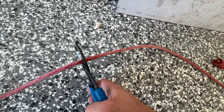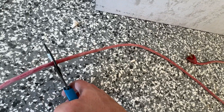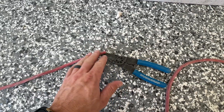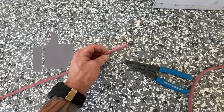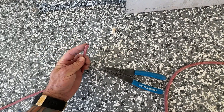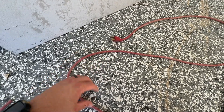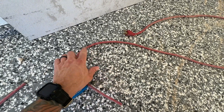We have a three-foot cabinet and we need to go a couple feet out when we pull the appliance, so I want at least six to seven feet of length. I'm going to wire this into my appliance. I have a video on my channel already and I'll probably make another one about how you can install your own male or female plug onto a damaged extension cord. The only thing you've got to pay attention to is the gauge thickness of the wire you're using.